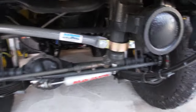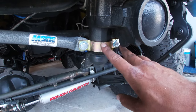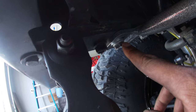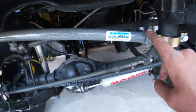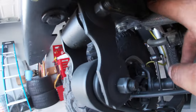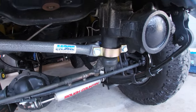I put the steering box brace on — it's so simple to do, I didn't even record it because it's really only four bolts. You take the clamp and put it around your steering box right above the pitman arm, keep everything semi-loose, then put the brace in between the two clamps — again keep everything loose. Remove the forward-most bolt on the shackle bracket, then put in the supplied bolt in front and the other in the back, which has a nice step so everything falls into place. I tightened the clamps down to 40 foot-pounds per the instructions, then tightened everything else up, double-checked all the bolts on the bracket, and that's the finished product.